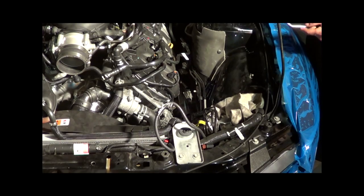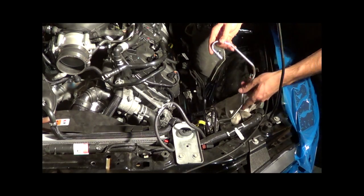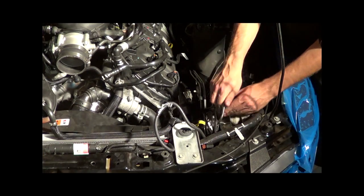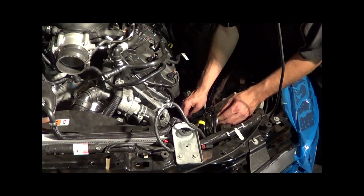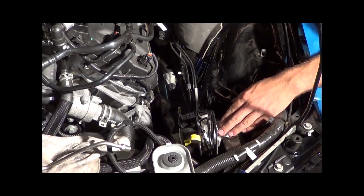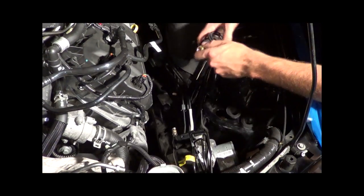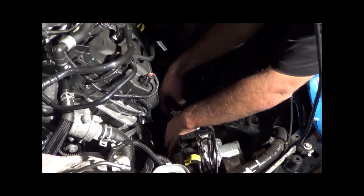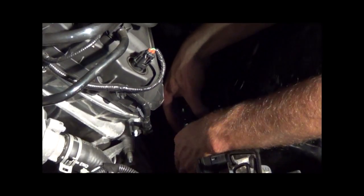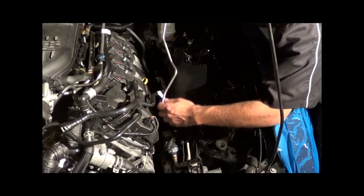Alright, we're going to install the line on the ABS solenoid first. Just take your line, put it through, spin it around. And we're in. Now that we got the front line mounted, we're going to need to install the Linelock solenoid. Leave the front line sort of loose just so we can get some adjustment. We're going to mount this in here, just get it started by hand. Next we're going to install the back line. It goes in fairly simply.